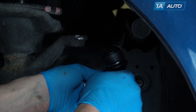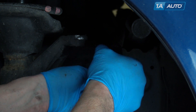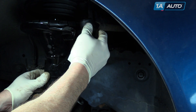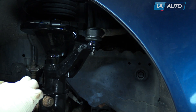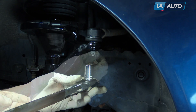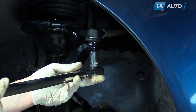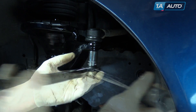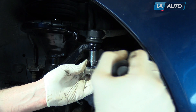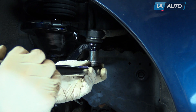Put the tie rod in — it should go right around to about where it was. Reinstall your tie rod and put the castle nut on. Tighten the castle nut to 32 foot pounds, and then tighten it any more as you might need to get the cotter pin through the hole in the tie rod. You can see the holes there — probably need to go another sixteenth of a turn.